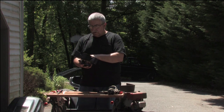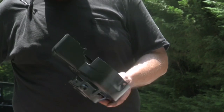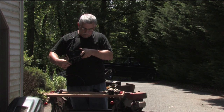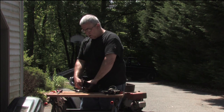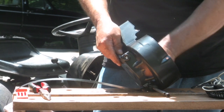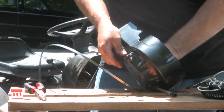Now we're going to put the spring back in. Remember what I said about that little hole — that hole plays a big part. So we're going to put our spring back into this hole; it's going to go into the pulley and lock into the small hole, and then we'll wrap it in. We put it in sideways — remember, we're going in sideways and then we're going to turn it. We're going to go in, turn it, lock it, and then turn it counterclockwise. Counterclockwise is going to wind it back in, so we just keep winding it back in with our hands, keeping a little bit of tension on there so it doesn't ride above the pulley.